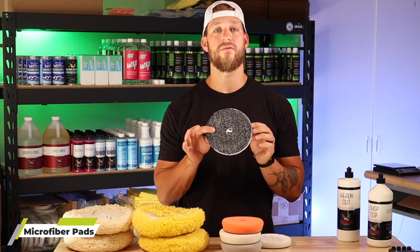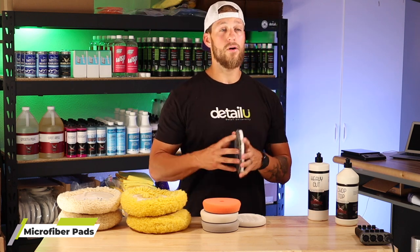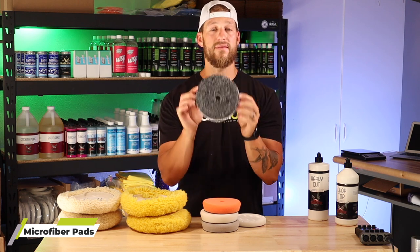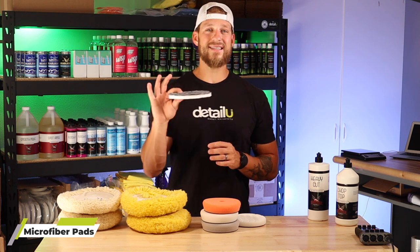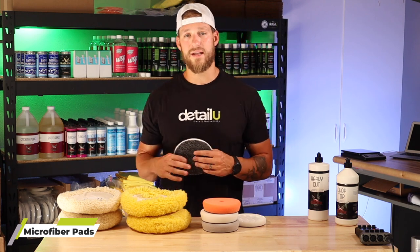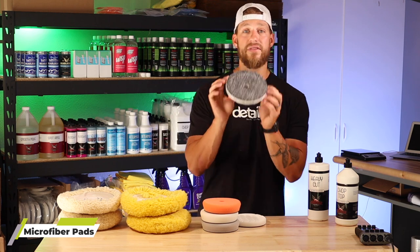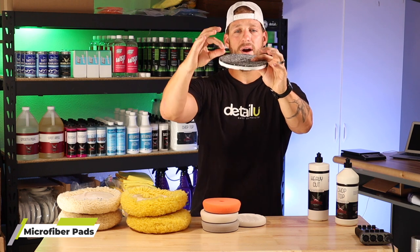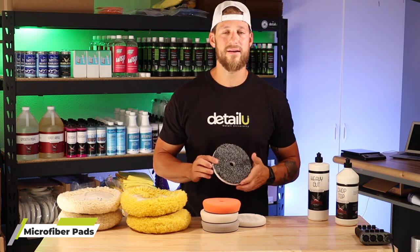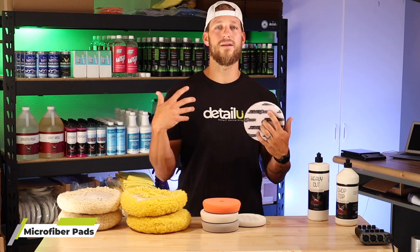Let's go over the one microfiber pad we have here. Microfiber pads are great for precise correction on harder gel coats like wakeboarding boats, and also great for correction on any gel coat. You can do a medium cut compound on a DA or forced rotation with these pads and get really good correction results. Also, if you're a high-volume boat detailing business doing a lot of boats and you're waxing, these are great waxing pads because they're so thin that product won't get absorbed — all the wax and sealant will sit on top, which ensures you're not wasting a lot of product.